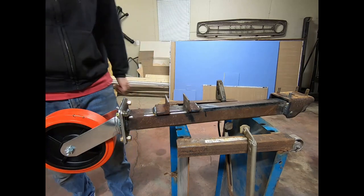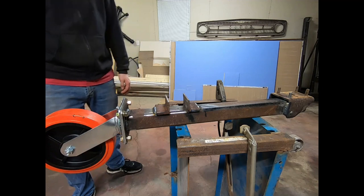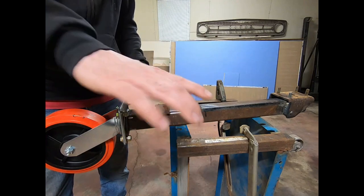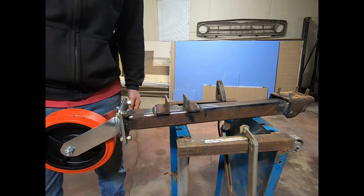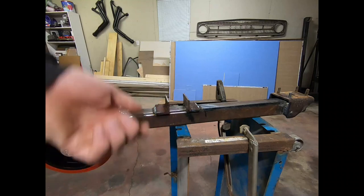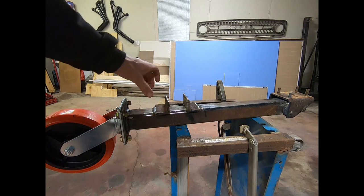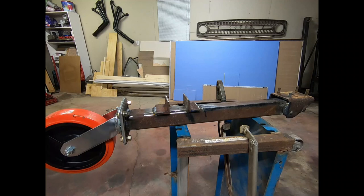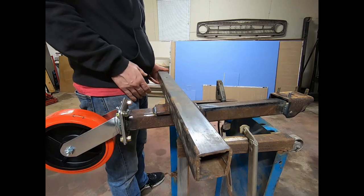And I'm just trying to think, what's a good simple way to do it and it to be sturdy and able to do what we want. So, you know, obviously we have one of these on one side, the other side, this bar would run across here like a piece of tube and kind of give it like an H frame, so to speak. And then ultimately you can tie this rear section with the front. Now we'll do the same thing in the front too, just like this. It's basically two pieces of angle opposing each other. And then I've got my cross tubing and it'll set down in there.